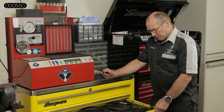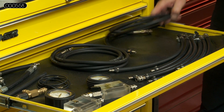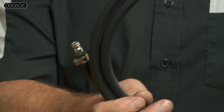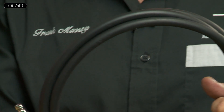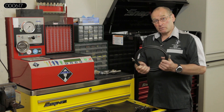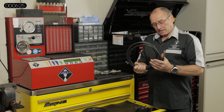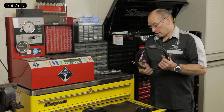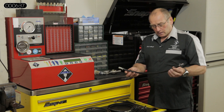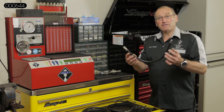I'm going to look at some of the modifications we've done. I mentioned the ability to actually fit the gauge in the driving compartment of the vehicle. To do that, we obviously have extension hoses. These hoses would be connected to the fuel supply, usually under the bonnet. With minimal adjustment to the bonnet, these hoses can pass through it — the bonnet will be securely closed, allowing clearance for the hoses at the trailing end, not the leading edge. They would then pass through an open or partially open window, allowing the gauge to be in the vehicle measuring real-time pressure and flow. We also have other extension hoses which allow freedom of movement within the engine compartment, depending where the fuel filter or hose access points are.